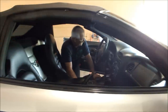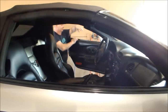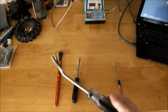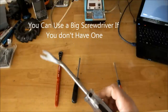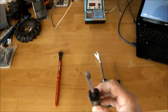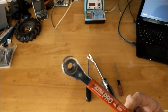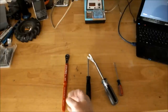First step, put the window down and pop the hood. To do this job you need a few tools: a small standard tip screwdriver; a door panel prying tool, which you can get at any automotive supply place; a T30 Torx screwdriver — see the funny end on it, you've got to have one of these; and a 5/16ths ratcheting socket wrench, which is for the removal of the battery terminal. You need these to take the door panel off.